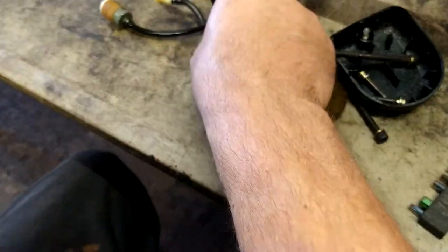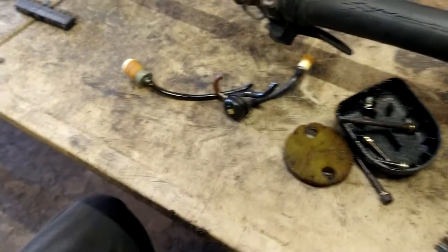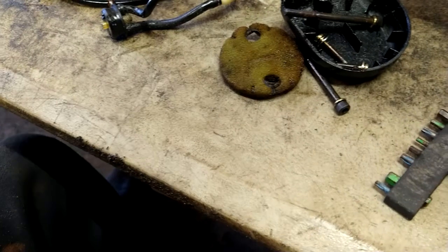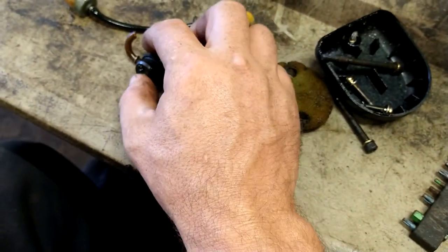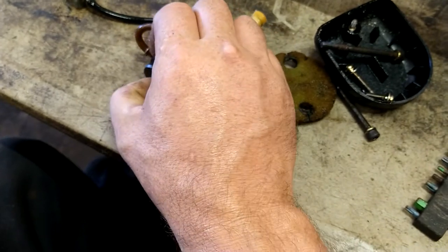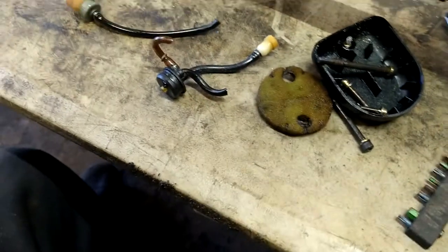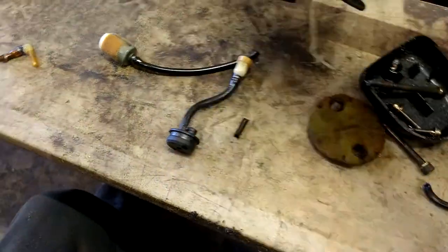The black line is the fuel filter line. We're going to leave the vent line alone — we don't have to mess with that. The return line's got this nipple, but we don't even use those nipples — it's not even important. We'll get that right out of there. So we're going to remove these two lines — we don't need this nipple anymore.